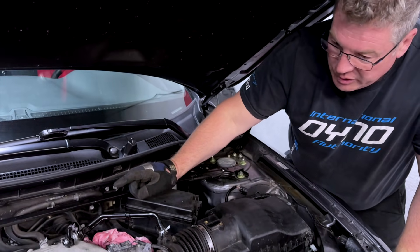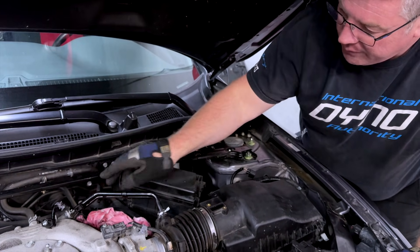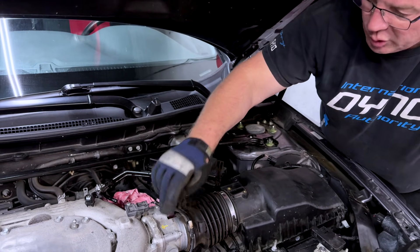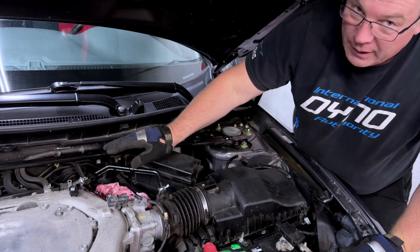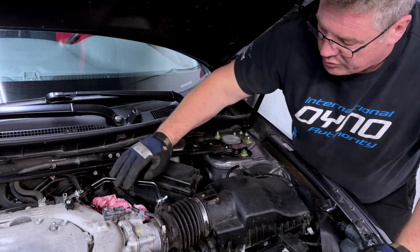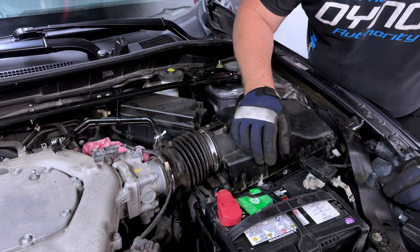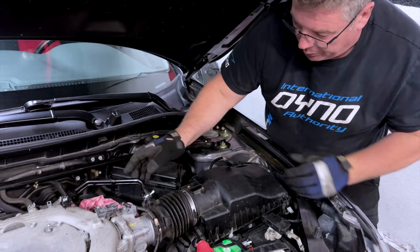Part of the PCV or the recycling system goes back into the intake just before the throttle body — we've disconnected that. There's also a coolant passage that goes up and into the throttle body to warm it in cold weather. In order to make it more responsive, they put a little bit of coolant through the throttle body to warm it up and circulate it. We've also undone the MAF sensor and the basic clamps that hold the top of the box to the throttle, and should just be able to pull it out now.